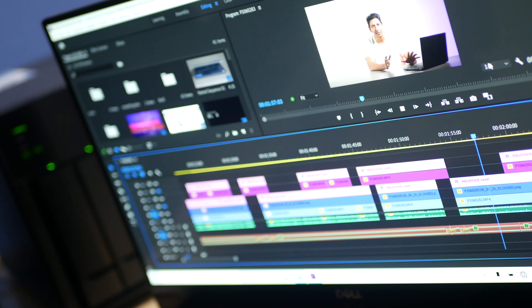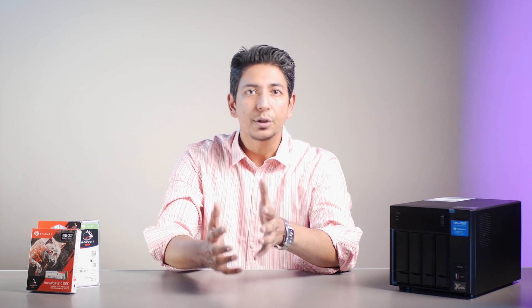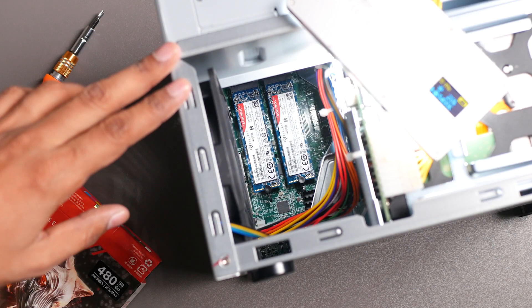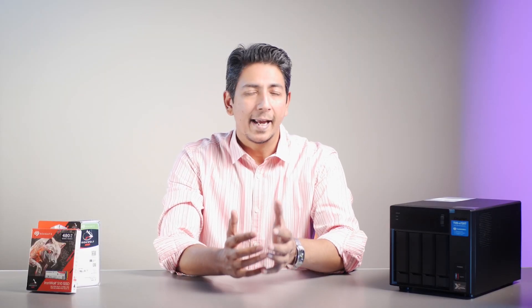All of this setup is enough to cater to video editing needs for up to four people working on full HD footage — scrubbing through video and real-time playback works just fine. But for 4K real-time editing and playback, the current configuration on my QNAP can accommodate two people fairly well, and that's due to the IronWolf Pro NVMe SSD caching. The read and write speeds alone are not enough for multiple video editors working on 4K footage over network storage, and this is exactly where the SSD cache plays its part. My video project takes around 200 GB, and with two people working on 4K footage, there is enough cache to read and write up to 500 GB of data, allowing us to work on full resolution using a Thunderbolt connection.